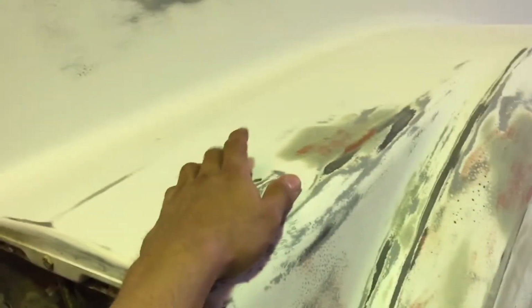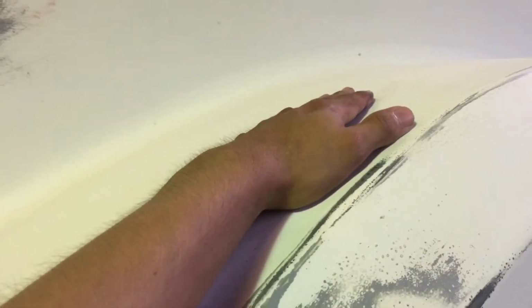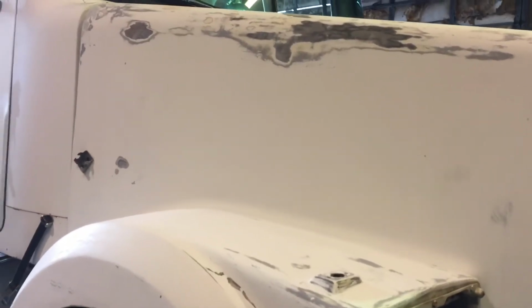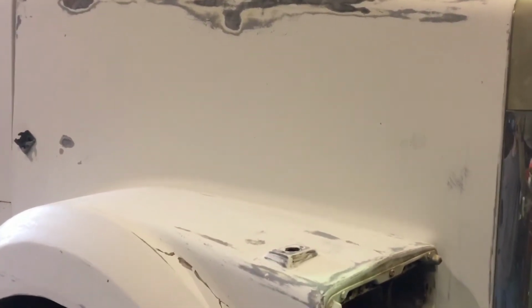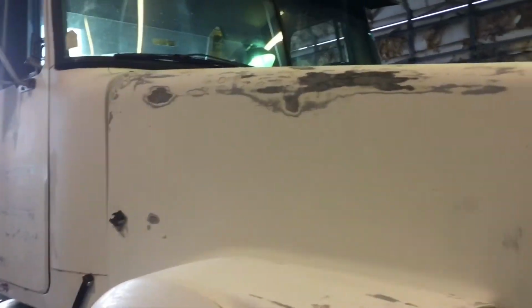So like I said, after I do the body work tomorrow, I'm going to just start sanding: 100, 150, 220, up to 1500. Once I get to the 100, I don't really need the Bondo or any body filler anymore, because it's all sanding down. By the time I get to 1000, and what is it, 1200 or 1500? I forgot what I said. But by that stage, I'm going to wet sand it and then clean it off with a wet towel. Anyway, I still have to sand these other parts, so the dust is going to come back.